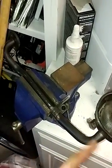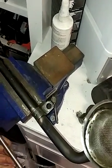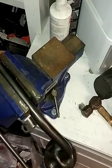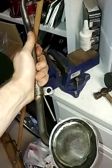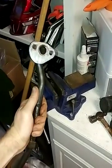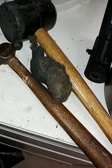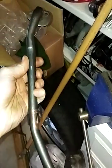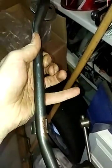I needed to clean inside the tube, but I couldn't do that with the screen in the way. The flange was good but really gunked up, so I threw it in the vise. I used some degreaser, a file, and triple-aught or quad steel wool — real fine stuff — cleaned it up, shined up the pipe and the tube. You can see the weld under there now that all the gunk's off. Those marks on the side are just from the vise.